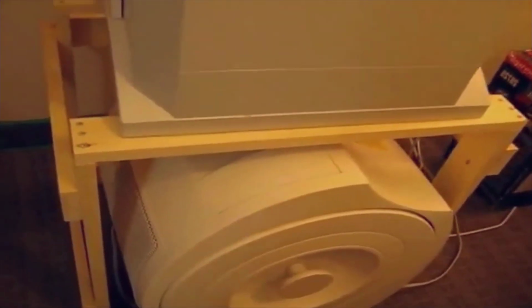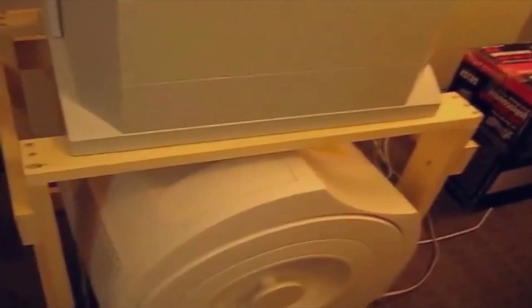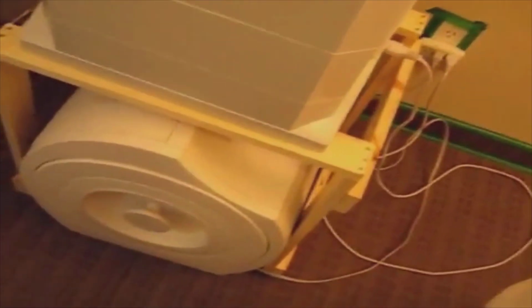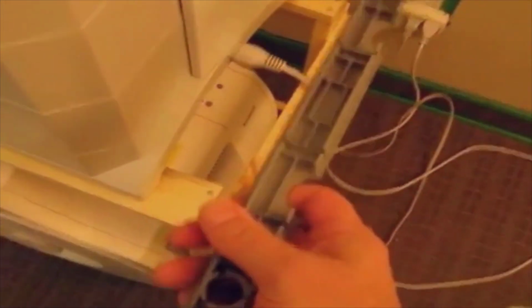And that is really the unit that we can use to best compare this unit to other units on the market. Now, the Austin HealthMate retails for about $500–600, so it is substantially less expensive than the IQAir HealthPro Plus here. The HealthMate does output at a slightly lower rate. It outputs at about 250 CFM compared to the 300 CFM on the IQAir. But the more important distinction to make here is the fact that the HealthMate, its gas filter, contains about 3 times more gas filtration media than this IQAir.